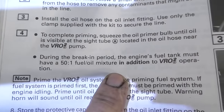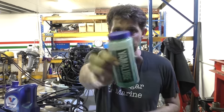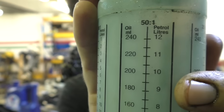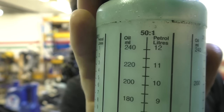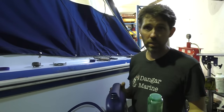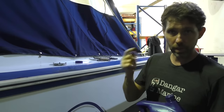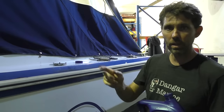The manual says that during the break-in period, the fuel tank must have 50 to 1 mix, so that's what I'm going to put in now. The owner told me he put about $70 in the tank, which is maybe 40 to 50 litres. I'm going to use this little Yamaha container — I really like these. You just find your ratio: for 50 to 1, for 10 litres you put 200 mils, so it makes it a no-brainer. For us we're looking to put about a litre in for roughly 50 litres of fuel — that's 50 to 1. The next thing I'm going to do is go to the fuel primer bulb and do the same thing I did with the oil — just push the new fuel with oil in it through the line until it's coming out the end.